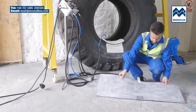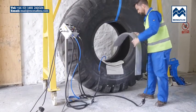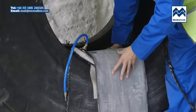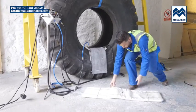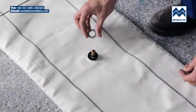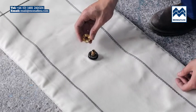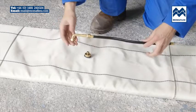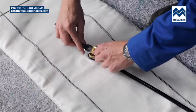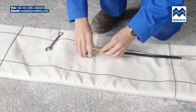Drop the wraparound heat pad centrally over the bead airbag so that it hangs equally down either side of the repair area. The label side should be facing the repair with the cables exiting to the right. If you haven't done so already, place the rubber and metal washer on the valve stem of the X-Lab WA airbag, and screw the valve nut down finger tight. Screw the black air hose onto the valve and tighten with the spanner. Loosen the valve nut back up to the air hose after it's been attached to allow free movement of the covers.